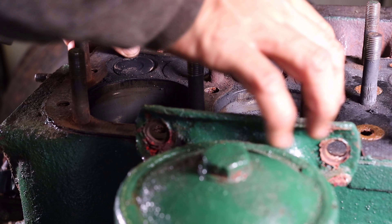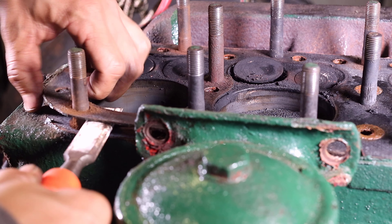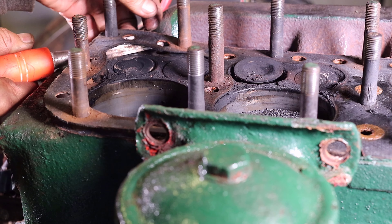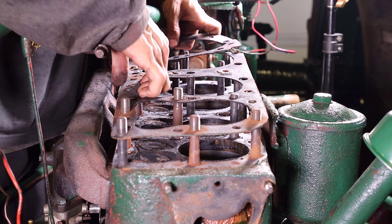This was initiated from coolant leaking from the water pump shaft. Also keep in mind that at this point I had chased the threads on the cylinder head studs. Chasing the threads will help remove the cylinder head and will also help to remove the head gasket. The videos leading up to this point will be in the playlist and some of them will be linked below in the description.